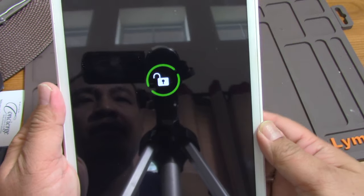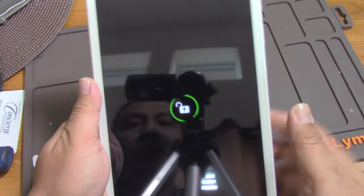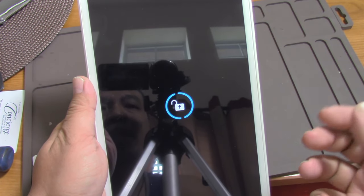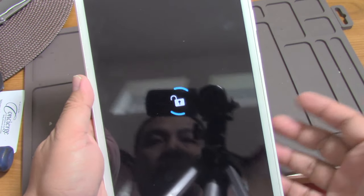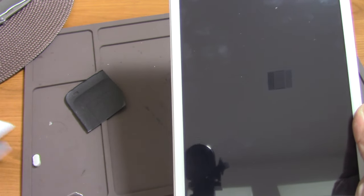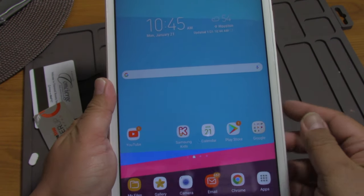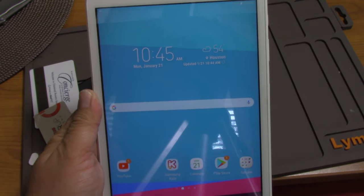And here it is. The reason why the screen was going dark or black is because of the screen cable getting loose — that's basically it. You can use different types of plastic to open it up, disconnect the ribbon cable and battery cable, put it back together, and here you go. Thanks for watching guys.